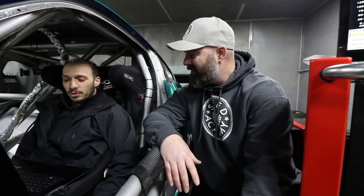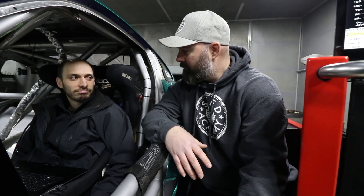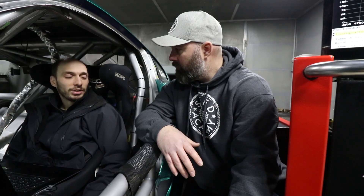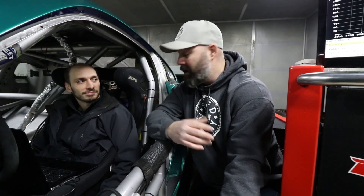What's next? We still need to get the flat floor done, and we need to build new air boxes — running without them today, and they'll probably cost around 40 horsepower. Before they were killing about 30, so it's significant. The car is getting pretty complete. We'll definitely get out early in the spring and get a jump start on the season, then get the hybrid system going hopefully by mid to late summer. We'll see some lap times with just the motor as-is before adding the hybrid, which will show us exactly what the hybrid is delivering on top of this package.